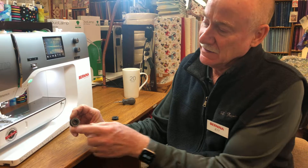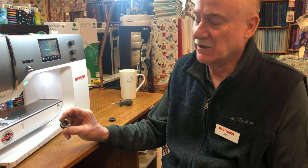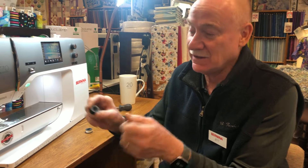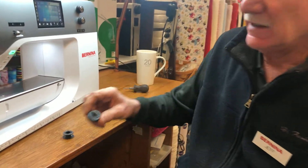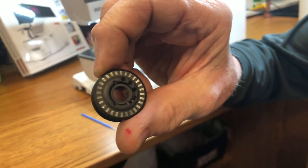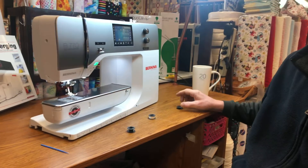The bobbins in your 7 Series have little mirrors or silver marks on the outside. These silver marks are kind of fragile — they will wear off, especially if you have a lot of lotion or use sanitizer on your hands and touch those silver marks. Here's an 8 Series bobbin and if you look, almost all those marks are gone. The machine has to be able to see those to know if the bobbin is spinning and to let you know if you have bobbin thread.